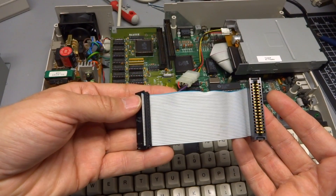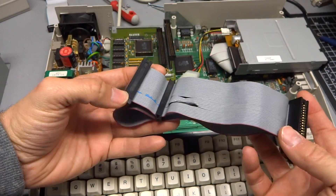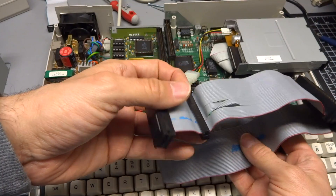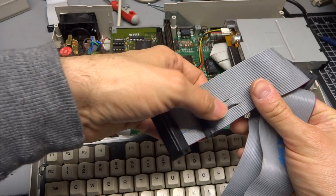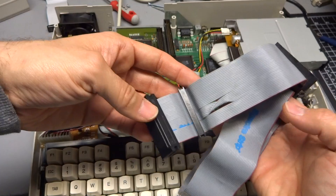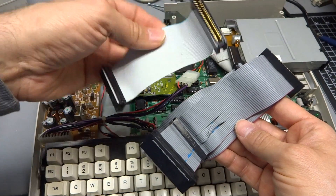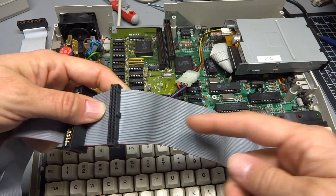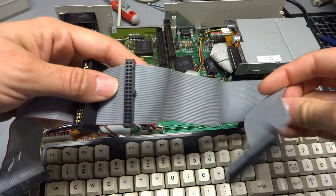This is the original cable that came with the Tandy — as you can see, it does not have a twist on it. This here is a standard PC floppy drive cable. If you know your PCs, the A drive is always connected to the end of the cable, but as you can see there's actually a twist in here. This is what allows you to hook up two drives to the same cable and have one be A and one be B. But this is actually a problem on the Tandy. Even though the original drive has a straight-through cable, one might think we could just use the straight-through part to connect the 3.5 inch floppy — but it actually doesn't work.